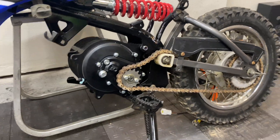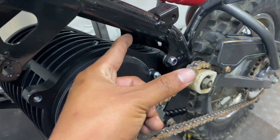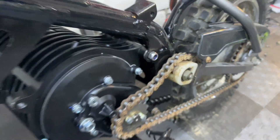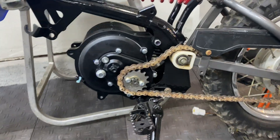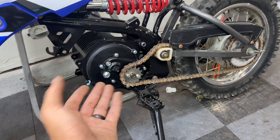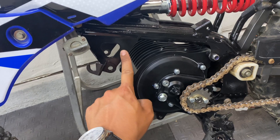Here's how I'm planning on having the motor mounted on the frame. The distance between the two mounts on this part of the frame is conveniently almost the same exact width as the mount on the motor. I just had to add three washers on each side to get the motor nice and centered so the front sprocket lines up with the rear — that is the most important part. The motor almost looks like it belongs there, but I want to rotate it clockwise a little to tuck it closer to the frame, so I may have to fabricate some tabs to get the motor mounts to bolt onto this part of the frame.